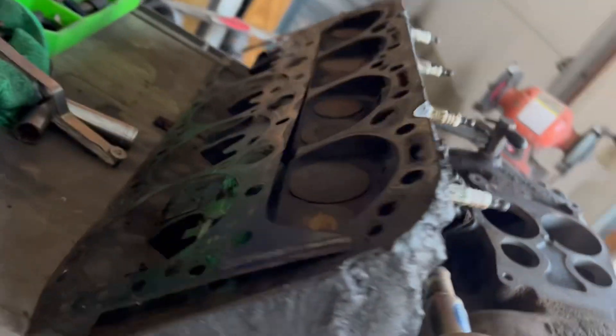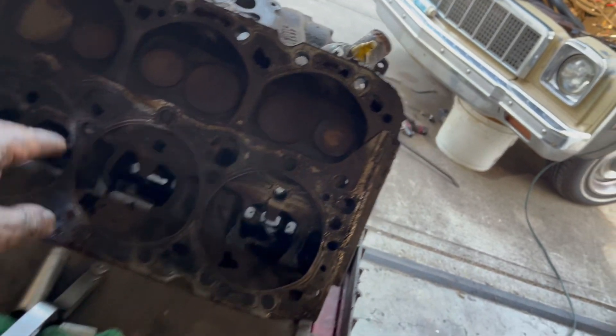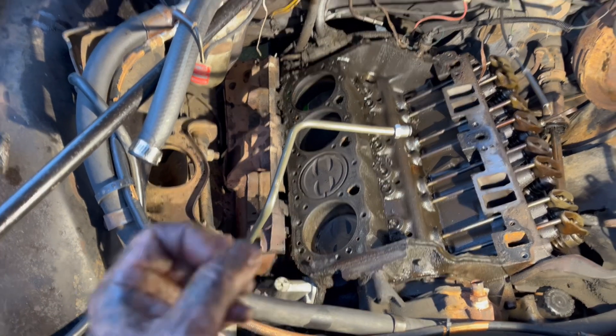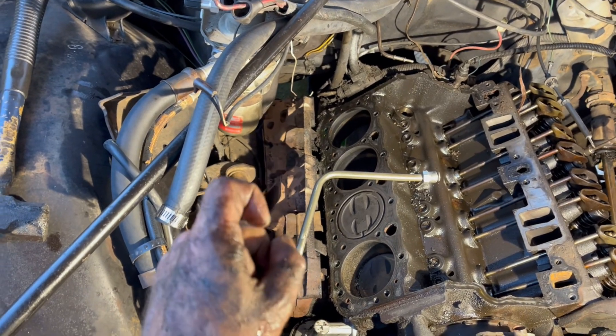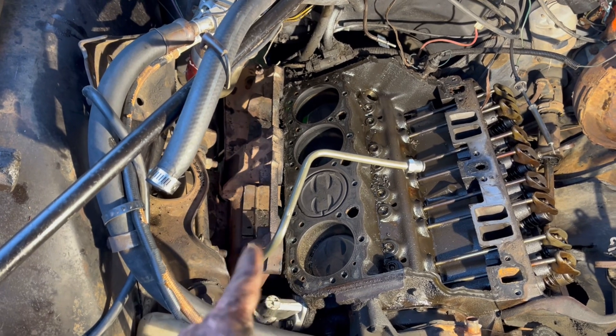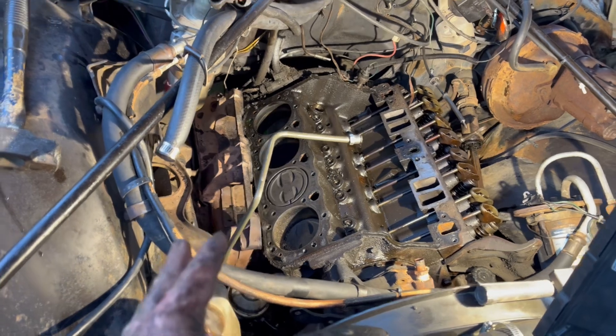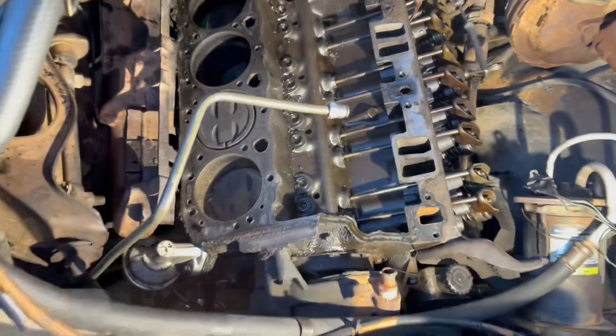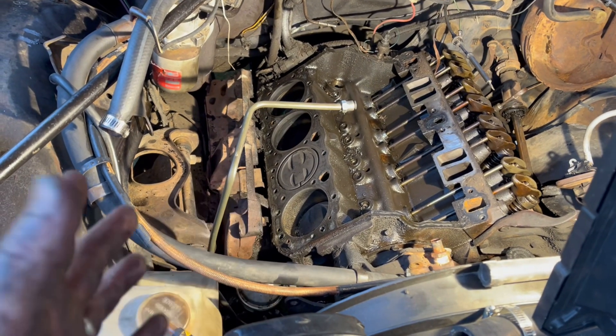We're back, much later — ran into a bit of a snag. I did manage to get the passenger side cylinder head off. It looks fine. Those are the big 882 76cc heads that we're getting rid of, and we're going to put my nice 55cc heads on. The problem is that this is a California car, and while the exhaust manifold bolts to the head came off just fine, the bolts holding the manifold to the exhaust Y-pipe I cannot get off. So I had to get the cylinder head off with the exhaust manifolds still in the way — which on a small block Chevy is no small feat.